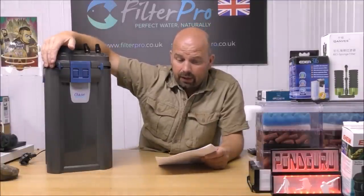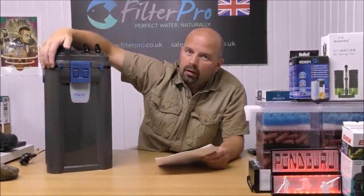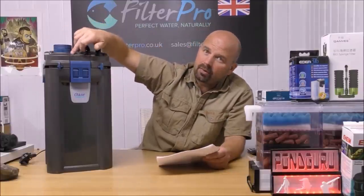There's also a vent button for effective water intake — a fast and easy start-up when installing and after cleaning. That basically relates to how you prime the pump. There's a floppy one-way valve. You've got one near the top of the pre-filter and one at the bottom. When you press it, it draws water in one way only, towards the pump.